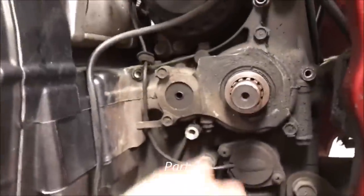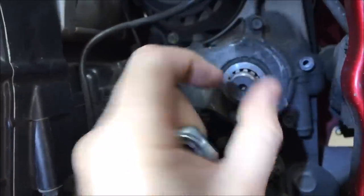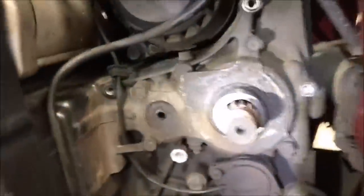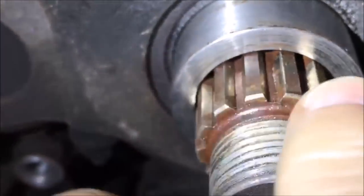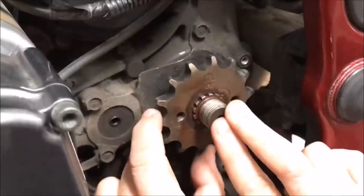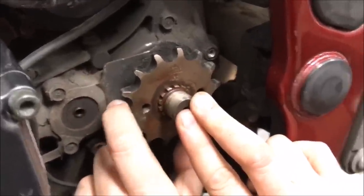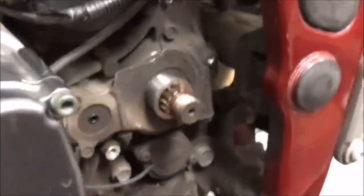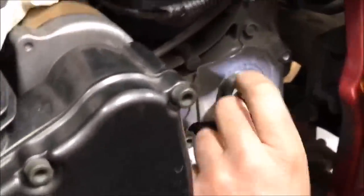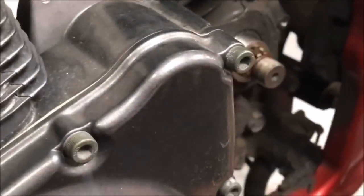You saw the video we did yesterday - the nut was torqued but the sprocket was loose. So we have it off now - check out the wear, see the rolled-up lip there. We've got the old sprocket here, see that play in there? Even with the nut torqued we had that slop. We're putting new sprockets on, but we have spline damage on the transmission shaft from this not being serviced.